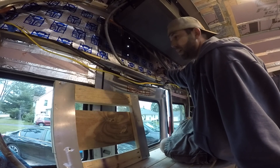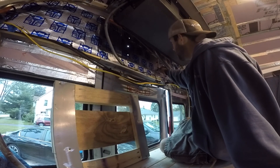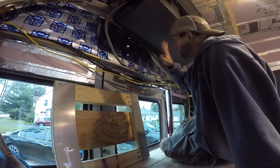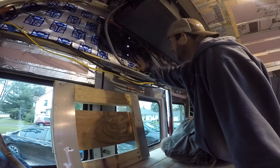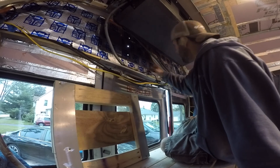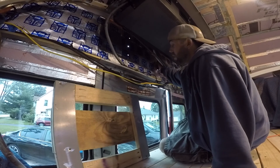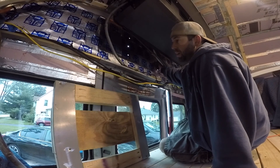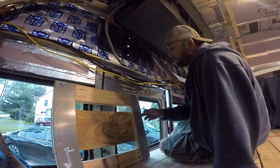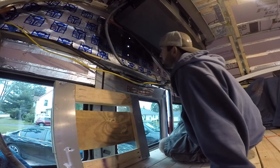Then I can check all of my holes and drill it all the way through, because I'm going to have to take it back out and put it on the bench. Then I will end up bolting it all the way through, and that will provide integrity on the inside as the unit provides weight on the outside, so it'll draw together. That's why I added the metal on the outside of these two by fours for structural integrity — the metal is going to hold the lumber nice and tight.